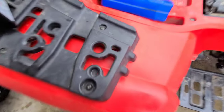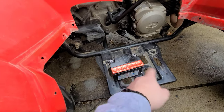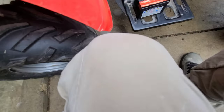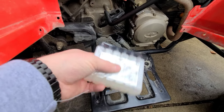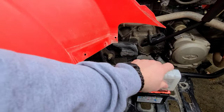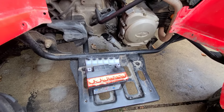Get your battery. If you've never done one of these before, it's not hard. Put it on a flat surface, pull this off — they give you the acid solution to throw in there. Pull that off, undo the black cap, and dump it in there, and then you trickle charge it for a while. I'm gonna go ahead and get that done and I'll be right back.